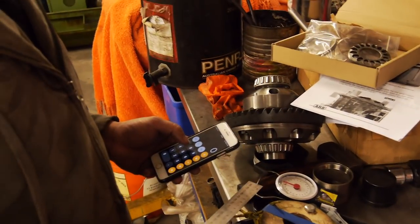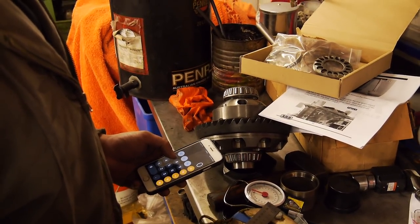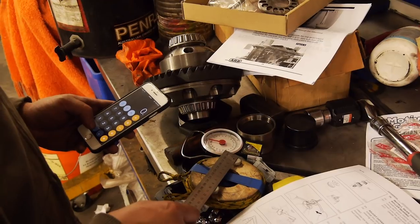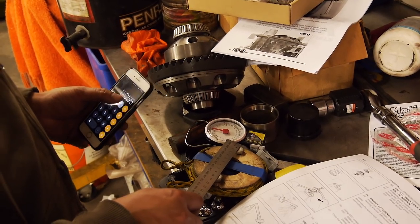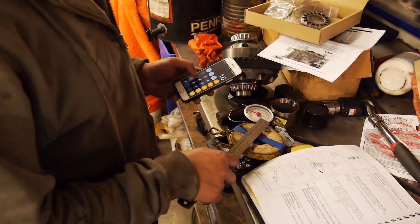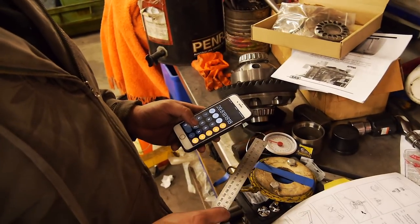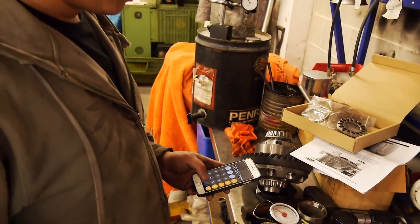1.64 newton meters, so it's newton times meters. So the force should decrease as the distance gets bigger. So we got 5.5 centimeters. 0.55 centimeters, 50 centimeters, 500 centimeters. Yeah, 5.5. 1.64 divided by 0.055. 30 kilos, that doesn't seem right. Force times distance. No, then divide by 9.81, gravity. 3 kilos. We're almost there, it needs to go a little more. We're at about 2 kilos now.